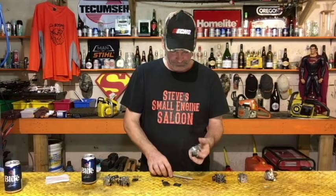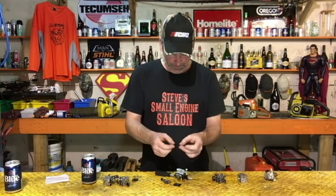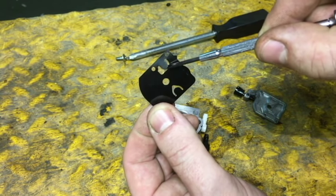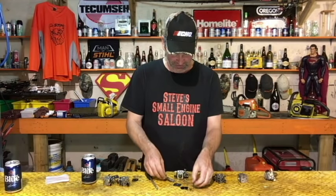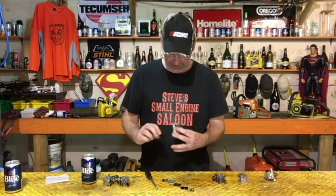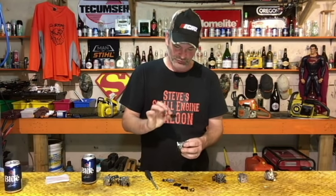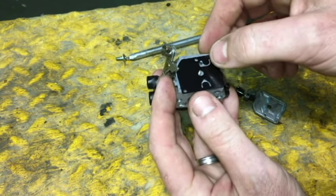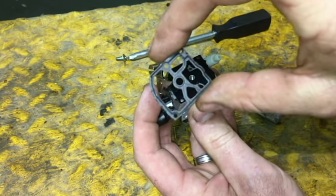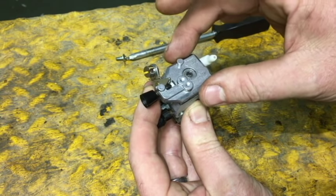Your fuel pump diaphragm — you can identify it because it has two little flappers on it that flap up and down. You also have your fuel pump gasket. Rip both of those off — might as well since you have your carb kit. Now on this one, don't get this wrong: your diaphragm with those two little flappers goes on your carburetor first, against the carburetor body. Then the gasket goes on top. Hold that down and screw it back in.